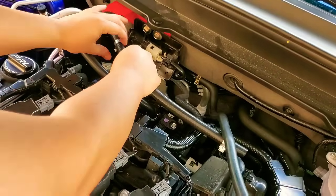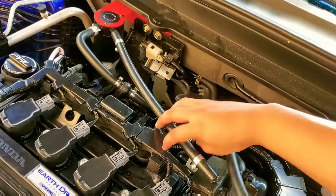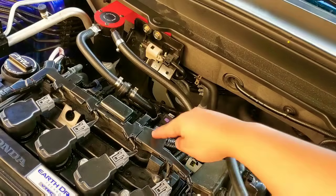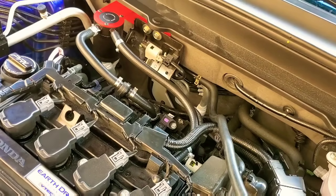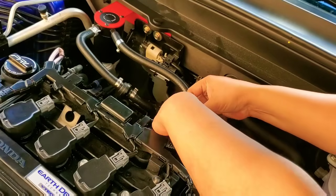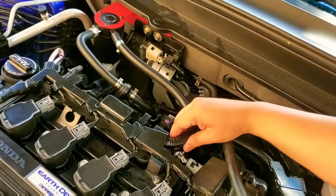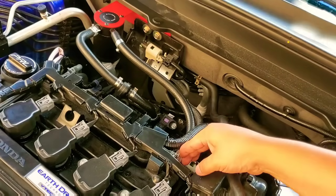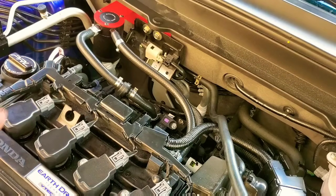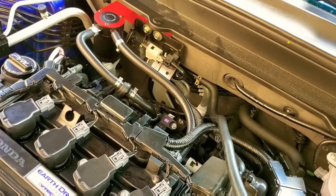Without further ado let's finalize. Put one end into the catch can, play around with the hose a bit, make sure it's seated all the way. Then connect the other one right where the fourth port plug is — where this harness is, right below it is that connector. Adjust the clamp, secure it down, then tighten everything else: the Allen screws, put back the bracket, tighten the catch can, and replace the engine cover.